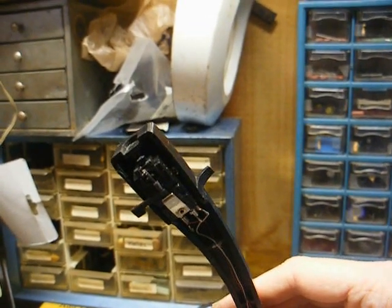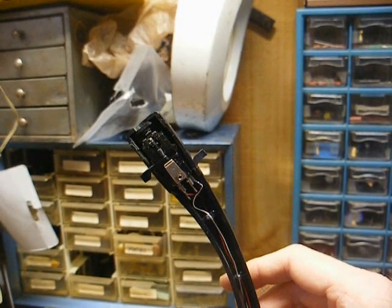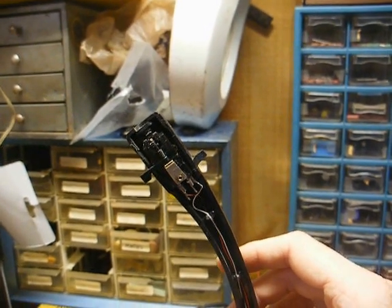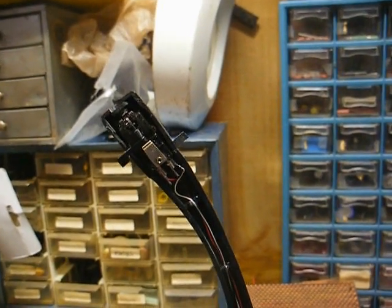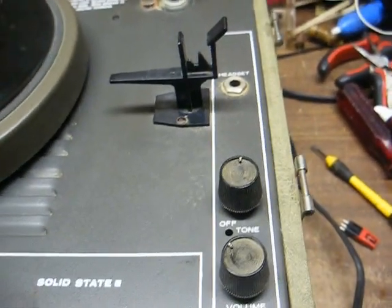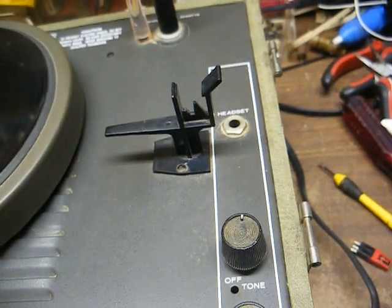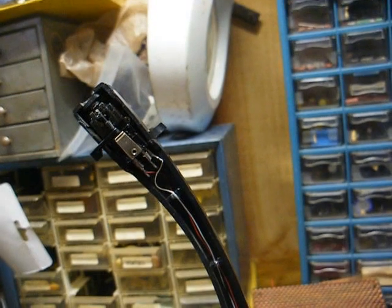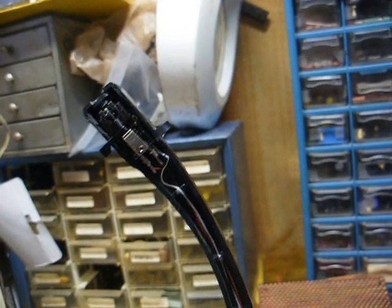The newest P226 cartridges I've gotten from the VM website seem to be hotter than the ones I was getting six or eight months or a year ago, and that's good because they more closely match the output of the old 89T cartridges, which means less work for me as far as having to modify amplifiers. I'm not saying there won't be cases where I have to modify the amp — no two amps are alike from one brand to another on these classroom record players — but since this cartridge appears to be hotter than what the former versions were, I should be able to use it without having to do a whole lot of amp modification.